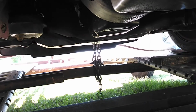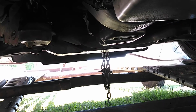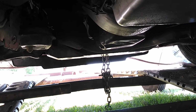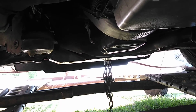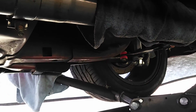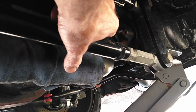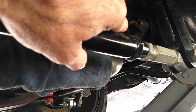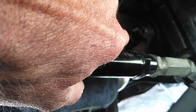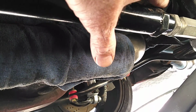non-coilovers. I have to do an ABS auto bleed and I have to add grease to all my bushings and do an alignment before I can drive the car. So that's what I'm hoping to do. I'm hoping to finish. I have to drill out that one little, we've drilled it out. I have to tap new threads and add a bolt, because I don't want to mess with pulling out this. And even though I've marked it with, you can't see, but I've used white paint in case I took this yoke off, or not the yoke, but this piece of the rear end off.